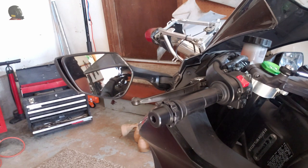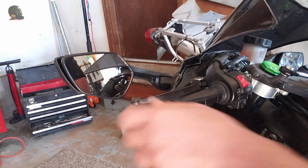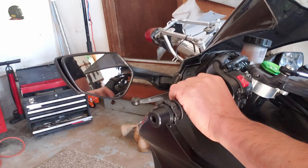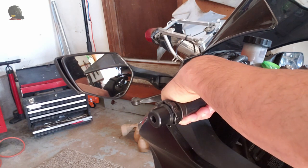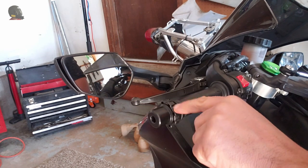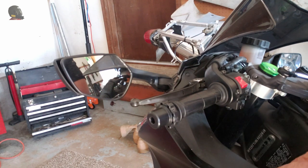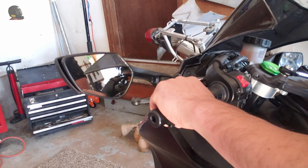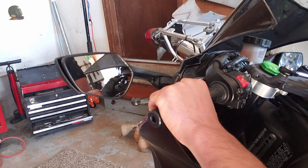I can engage the lock in two different ways. First, I can manually turn the dial to where I know it's going to be tight, lock the throttle, give it gas, let go, and the throttle stays locked in position — but it's not so tight that I can't roll the throttle back to stop manually. I can also roll the adjuster back to the letter O. The second way is by sliding your hand to the right, using your pinky finger and the palm of your hand as you give it gas, grab the throttle lock, and voila — throttle is locked into position.